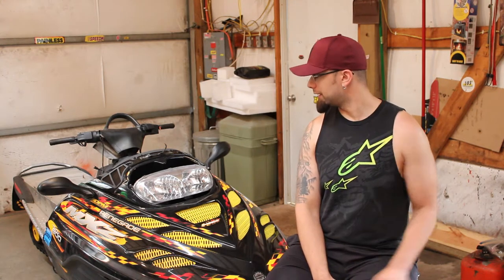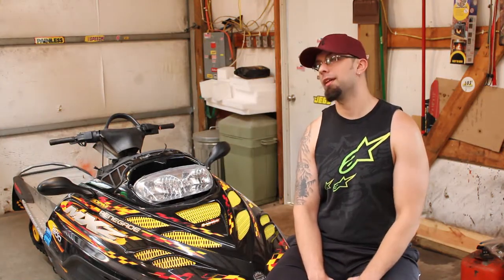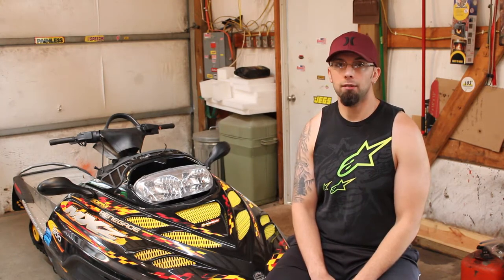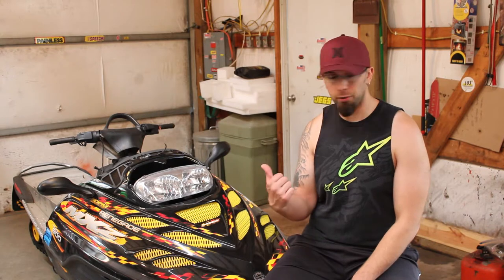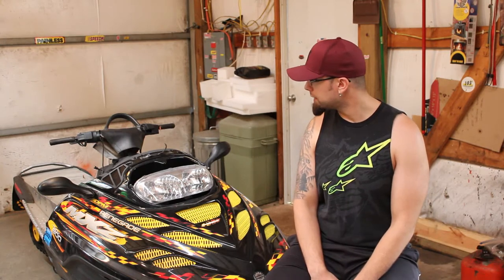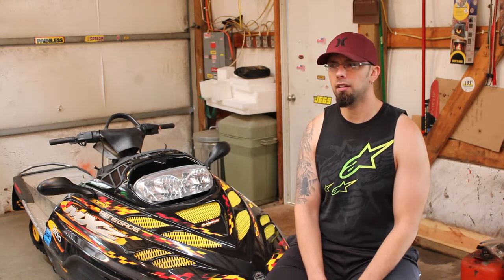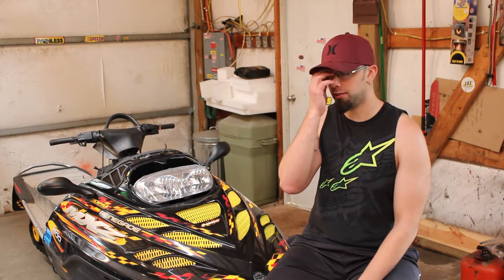There's more here than meets the eye. It's not a whole sled — there's really nothing left under the hood besides the chain case and the jack shaft — but we bought it mainly for the suspension components. It's a 2002 so it's got an SC10-2 in it, not an SC10-3 like I would have liked, but couldn't find an '03 for as cheap as this one. The SC10-3 will stay in the Everest, and the SC10-2 will go in the F-chassis, which is still a hell of a step up from the C7 that's in there. It's got good HPG rebuildable shocks on the front and rear, and I think it has an inch-and-a-half or inch-and-three-quarter paddle track on it, studded — not in the best condition but usable.